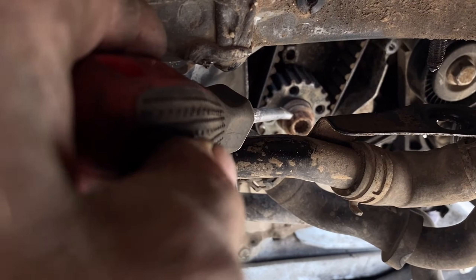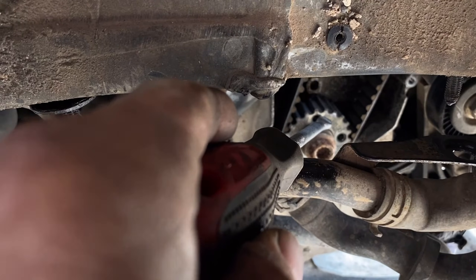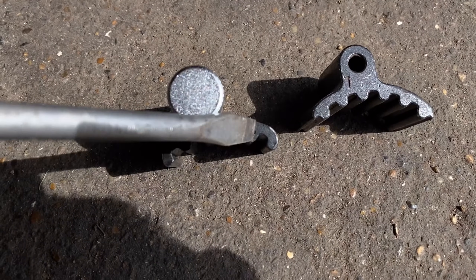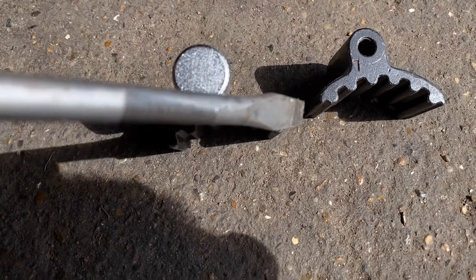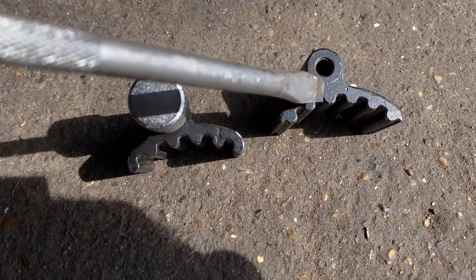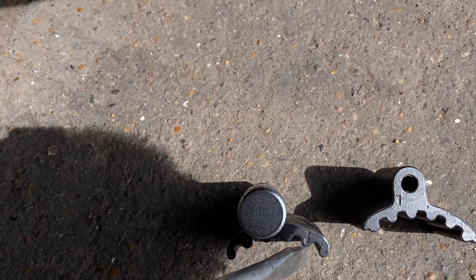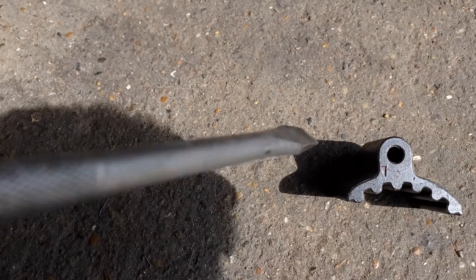It's a 19mm 12-sided socket to turn the engine around. Rotate the engine so that pointer is at about 5-to-12. Look at the top, get your pins in, and we go from there. If you buy one of these timing kits you'll notice you get two tools — the arrows are in different places. On this one the arrow is on the inside tooth, on the other it's on the outside tooth. Look at the bottom crank pulley to work out which one lines up with your cutout — our bottom pulley lines up with one specific tool, so use that one. My locator is at 5-to-12.